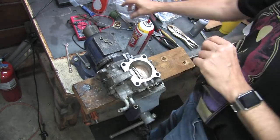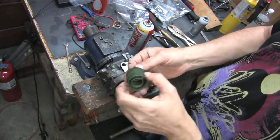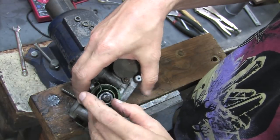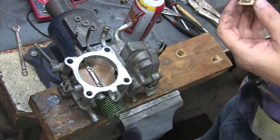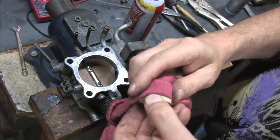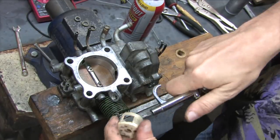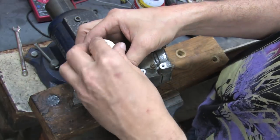The twin throttle spring thing. This is all safety equipment, so get it right. You get a tall skinny one and a short fat one. The tall skinny one goes on first and gets hooked around the spring anchor post. The fat spring goes on next and hooks above it. There's a plastic guide sandwiched between the throttle linkage and the springs that helps keep the springs separated from interfering with one another. The skinny spring pokes through a hole in the side of it.